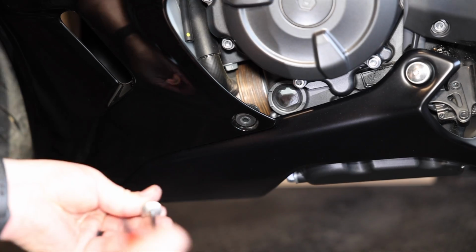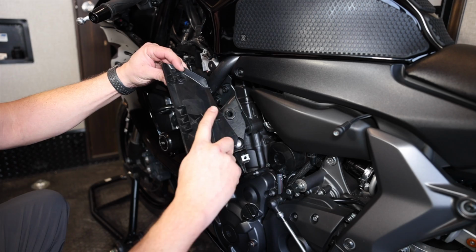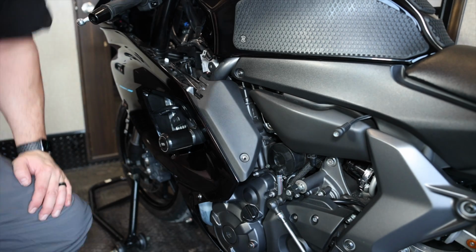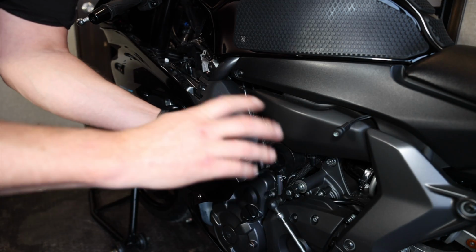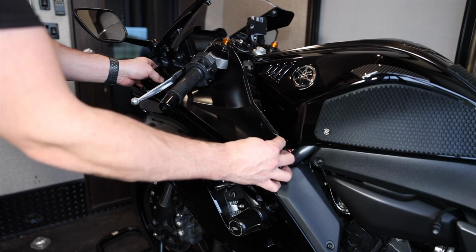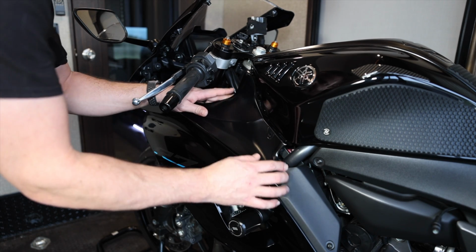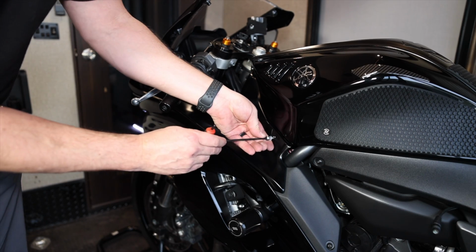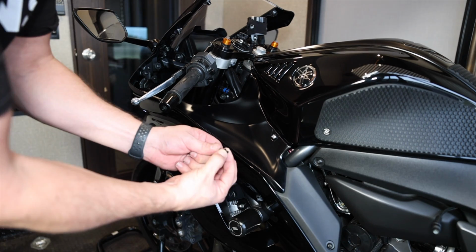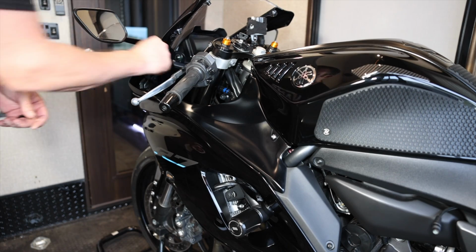Moving back over to the front, we have this 4mm here. So remember this plastic piece here, this goes in first, sinks in like so, lines up quite nicely for our bolts. Remember these are the two black 4mm that go right here. And for the final fairing install, put her under, set it down a little bit high, and then it'll slide its way back in. This 4mm here, and then 3 more of these little push pins. Just remember to pop the pins out. One goes up here by the gas tank, and then 2 up here holding the headlight in.